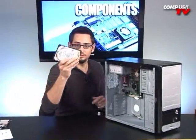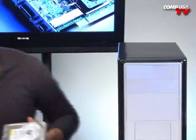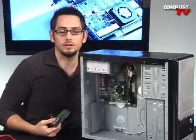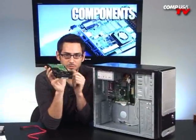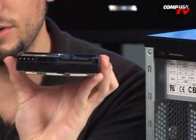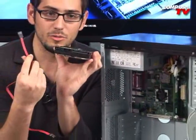80 gig SATA hard drive, SATA 2 power. Very simple. We're going to go ahead and screw it into the top bay here. So check this out — to help with cable management and make it a little simpler and look a little neater in the case, I'm going to mount the hard drive backwards. So instead of the interfaces facing back, since my cable is actually kind of long, I'm going to face it forward so that it stretches the cable all the way and there's less to hide behind the motherboard tray.